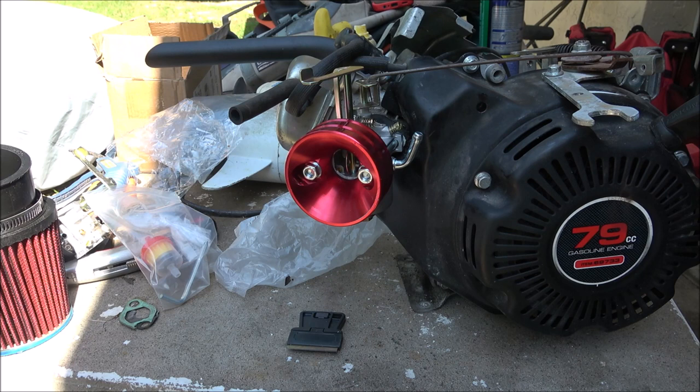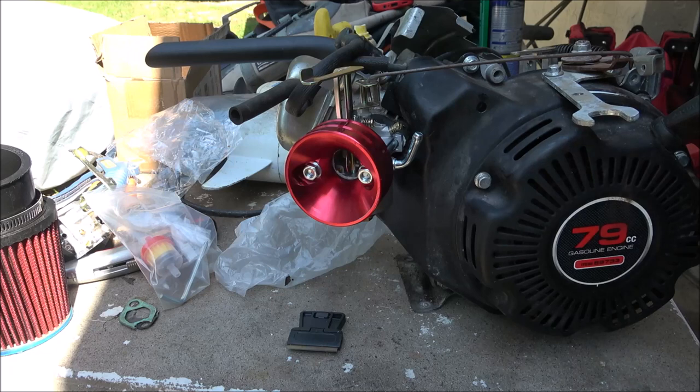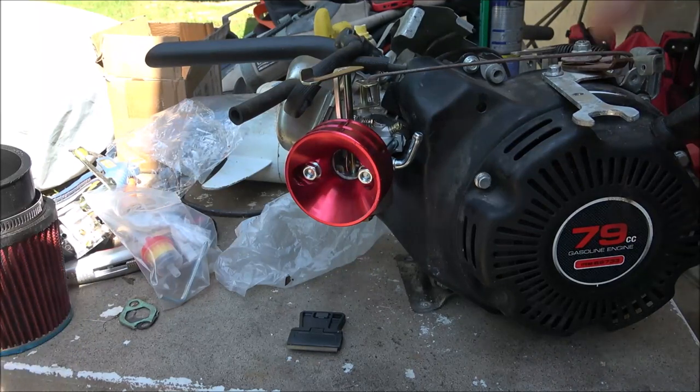And if a kid's going to be on it, they don't need all that speed, because when I first took it for a ride, it couldn't run wide open because of the carburetor, and I was running 20 pretty quick with it. So I changed this. I got a clutch coming, went with an 11 tooth clutch and a 72 tooth rear on a number 35 chain. So yeah, we'll see how that goes. Anyway, enough chit chat. Let's start this up again.